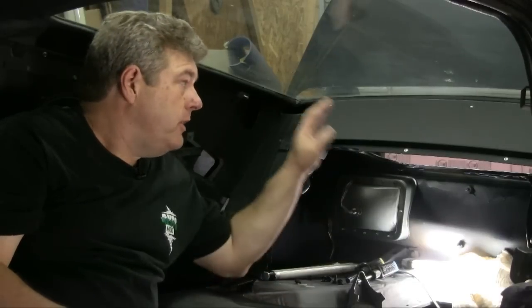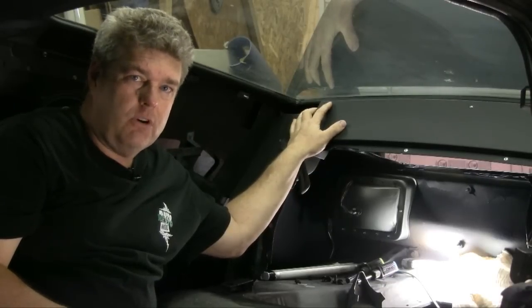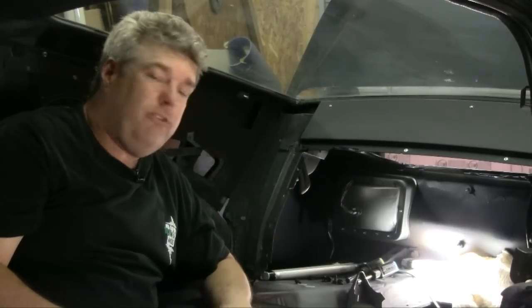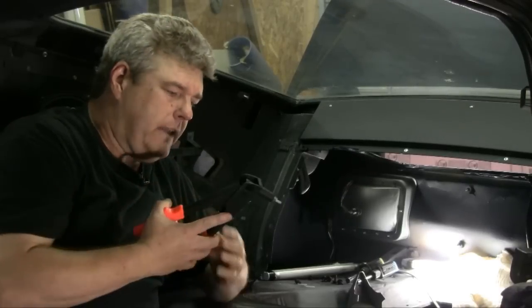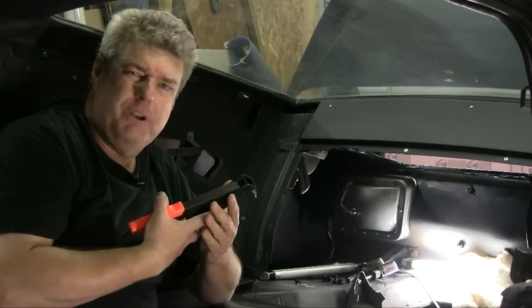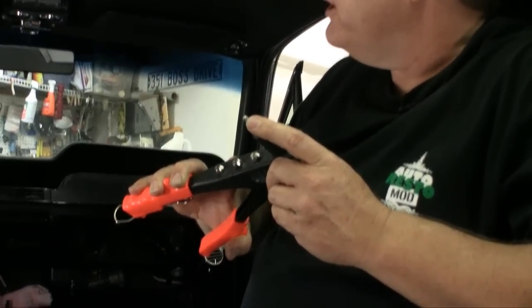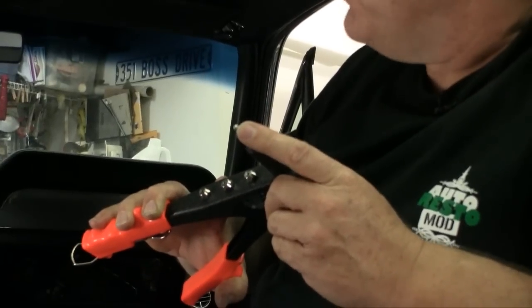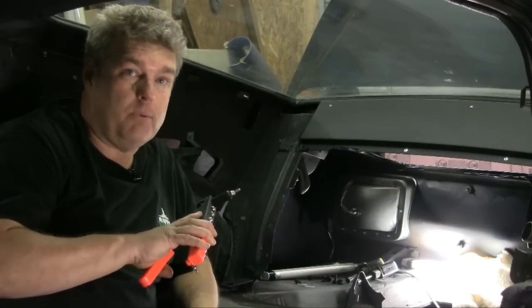One of the first things I'm doing is installing this plate that goes across the back window. You'll want to get new fasteners for this because a lot of times the chrome on them is pretty bad. New fasteners will just brighten up the back. You'll need a large format rivet gun like this one we picked up at a Home Improvement Center. You can get the correct pop rivets from National Parts Depot — they have the kit for this plate because it does require pop riveting.